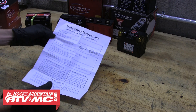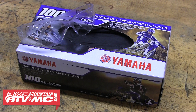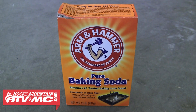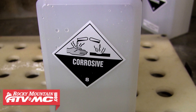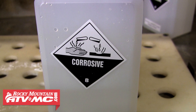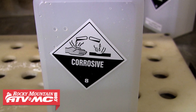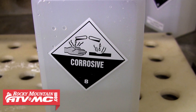We're going to start with battery safety. First and foremost, it's important that you read and follow any instructions or safety information provided with or on your battery. Safety glasses and protective gloves are required whenever you're working with the battery. You should clean up any acid spills immediately using water and baking soda to neutralize the battery acid. Keep in mind battery acid is toxic and can cause harm or injury. Make sure your work area is clean and well ventilated. The gases produced from batteries charging or discharging are potentially flammable and explosive, so take the necessary steps to avoid causing injury or damage.